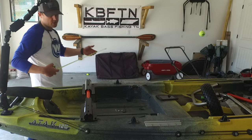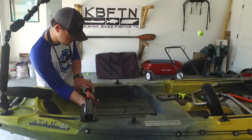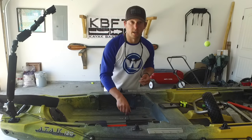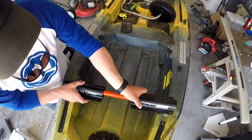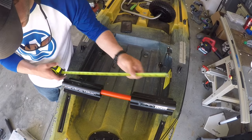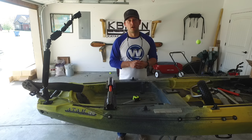So, get a quick measurement. We're at exactly 24 inches there. So, turn this over. I'm gonna put in these hex head locking screws. Basically, it mounts the knuckles to the spacer bar and keeps it straight and keeps it in position. Kind of call that hand tight right there. Take my measurement. Inches. Double check everything. Okay, I'm going to tighten down the hex screws all the way, and then we'll start marking holes and drilling holes.